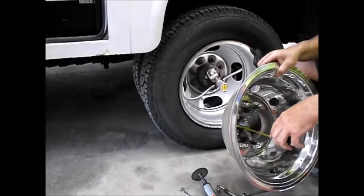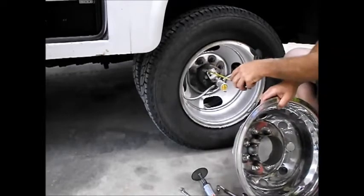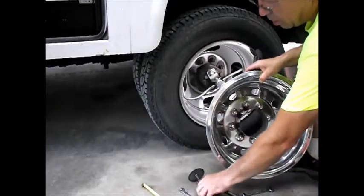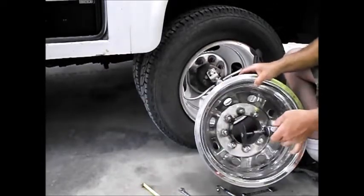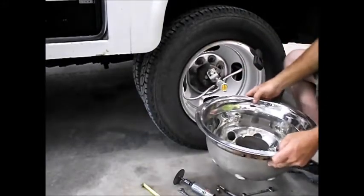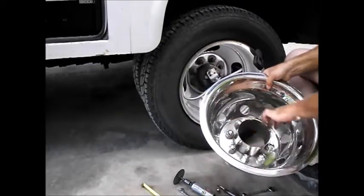You may want to go a touch less than three inches because this face here does not fit tight against the wheel — it's going to be sticking out. So what you don't want is interference of the corners of that bracket with this, so you may want to go two and a half inches out. Take and mark it at the two-and-a-half-inch location, then take an air die grinder with a cut-off wheel and cut through that. It takes about 30-45 seconds once you get onto it, and if you're doing just a few of them it works really well — though it does tend to eat wheels.